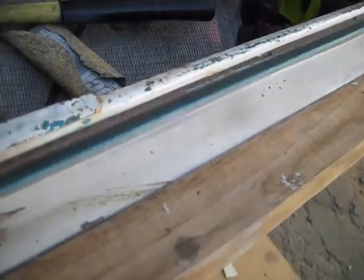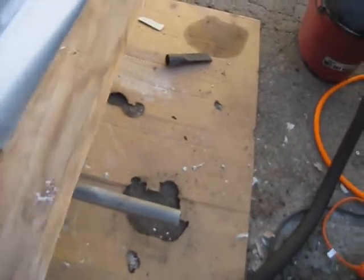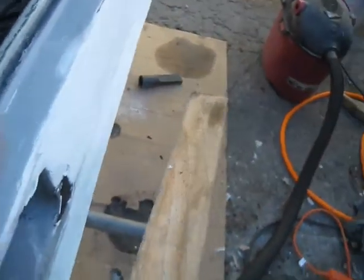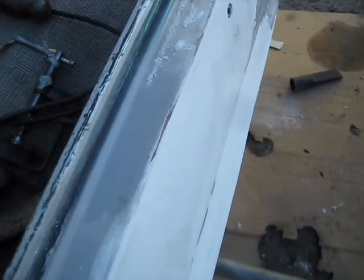Alright, look at this side from the tail light to the center, coming out just about 1/8 of an inch, just inside the bolt holes. So tail light to the center, looks like we're at 16, so we're a little high right here in the bottom. If we go across the top here, that looks pretty straight, and we look here, it looks pretty straight. So looks like we've got a high spot right in here, and just looking at it, that's what it looks like, high spot. I'll sand that down a little and see what it looks like.